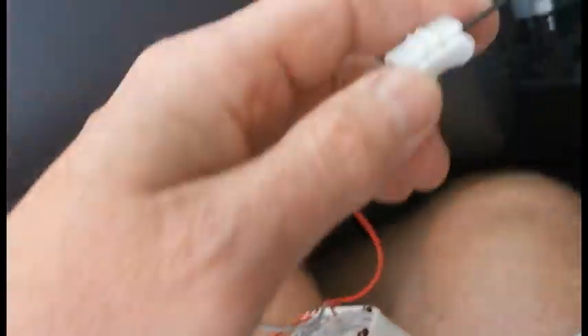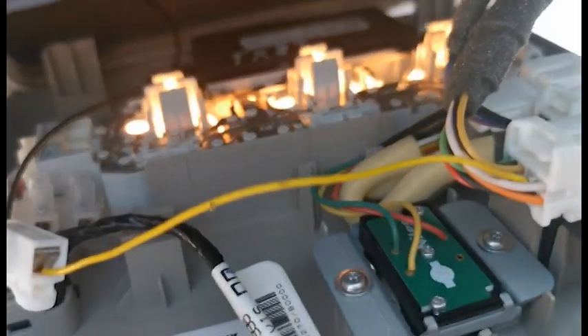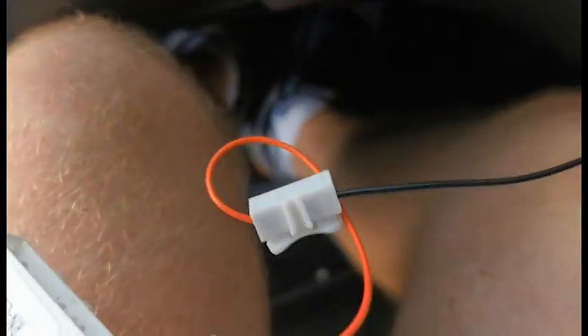We've got both these two mix and go to both of these two. Here you can see we've got an extra cable coming in. I've run that across here, all the way across here, up here, inside here, and up here. This is for the new microphone. You can see it's running up here, the connector in, and it goes into there — just one wire into the new map light unit. That's got the noise-cancelling microphone in it. You do need a new one of these — I've not tried it without, it may well work without, but from what I've read it doesn't. I ordered one off eBay for about £20, and then just put that one wire all the way down, tucked it behind all this, and this is where it comes in — it just adds into here.